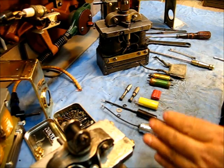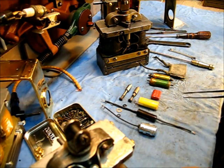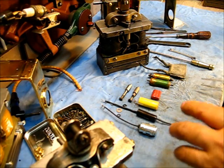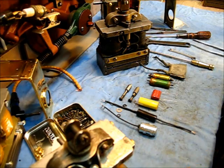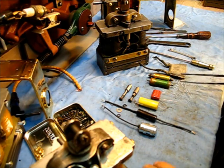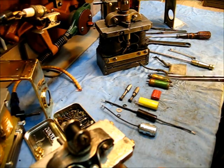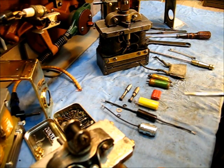The bottom line is: if you get anything out of this, please read the description on these videos — there's more information there. All of these will work. The only difference is price range. And the question is, what's the part number? The bottom line is, you don't need a part number. All you need to know is the voltage. These voltages usually start at 630 volts and go up — 1,000 volts would be better in these EK Magnetos since some of them seem to run high voltage. Let the minimum on the condenser be 630 volts and upward from there.